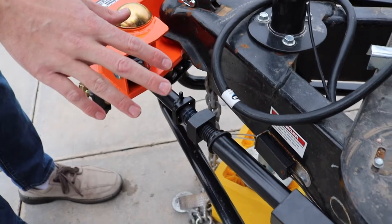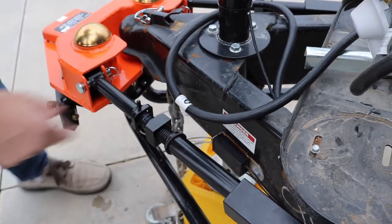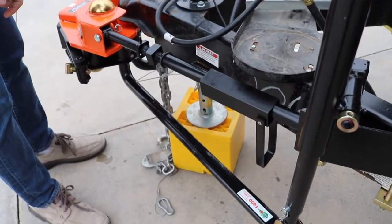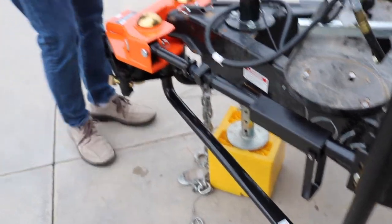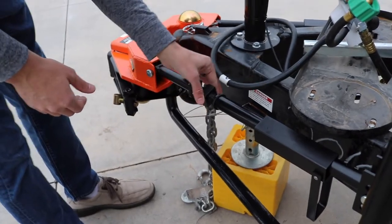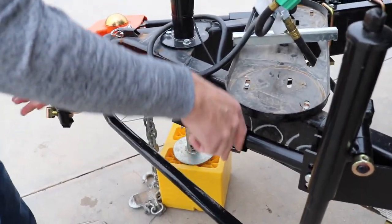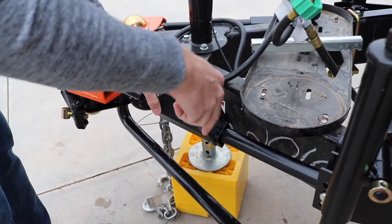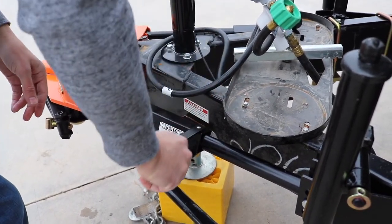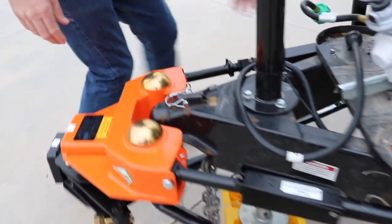This side is showing more threads than the other side, which means the frame assembly is a little bit further back on this side. That's perfectly fine as long as the top unit is perpendicular with the A-frame of your trailer. They put a nice cheater sticker in the middle so you can see where your center is. Then give it a half turn to tighten that up, and you're done with that side — then do it on the other side too.